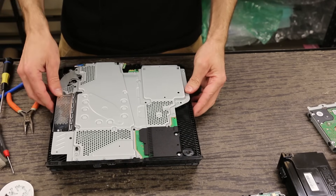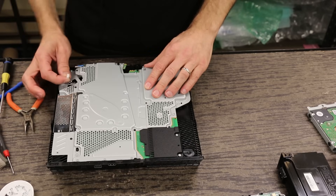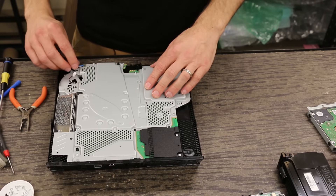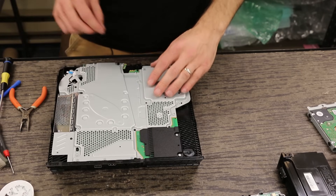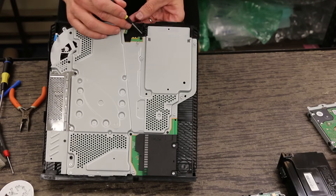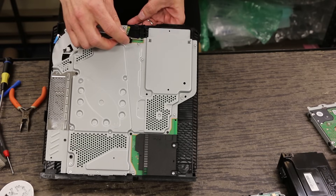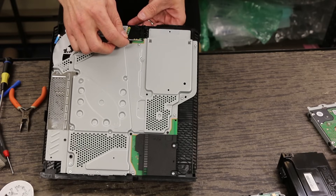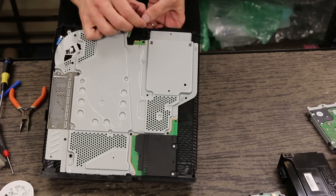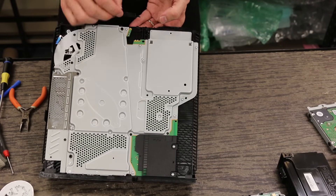The way I like to do this is I take the two cable connectors out I need. This one is for the fan that plugs into the side of the motherboard, and then this one is the cable that plugs into the optical drive. We've also got one new thing — this is the button for the power button for this new model. To get this off, on the top side there's a little hole and it just goes right in that little hole. There's a little clip there, so you just pull up on the clip and then that will come right out as you push it out.